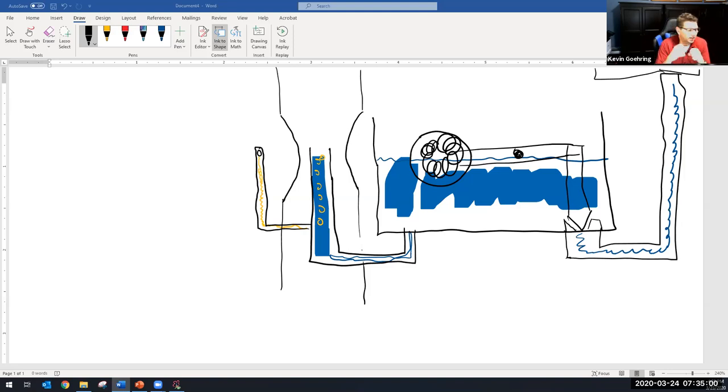The problem is the fuel is going to be in these giant globules. When you get the giant globules, you don't have enough surface area. It doesn't evaporate fast enough, it doesn't mix well enough. So to solve that and to get rid of the surface tension so it flows much easier, we want to introduce little air bubbles into the fuel — that's all we want to do.